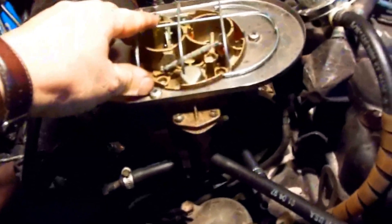You see this cloth on here? This is like a heavy, very thick cloth type of material — not cotton, but probably polyester or something. It looks like a good filter element. I'm probably going to use that instead, because I'm having a hell of a time trying to find the right size air filter for this. This just came with a foam filter and it rotted away.